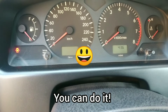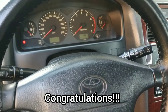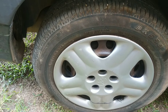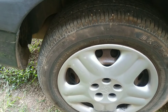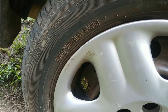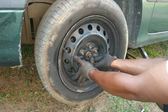So we'll proceed to take out the brake pads and also clean the wheel speed sensors on the front. Before taking apart any components, ensure that all your tires are matching because that could also be a major cause of ABS issues. In my case, my wheels are 195/60 R15 all around. Next, we proceed to remove the front wheel, support the vehicle on the jack stand, and then turn the wheel all the way to the left.